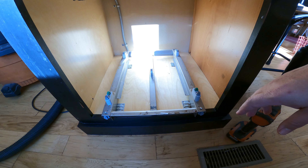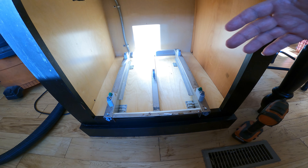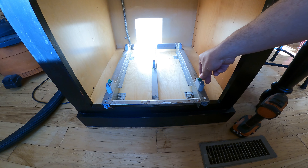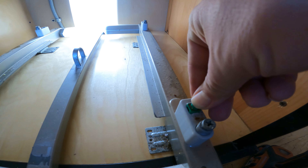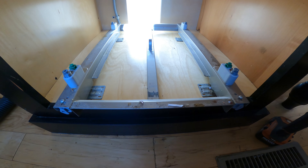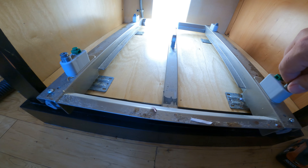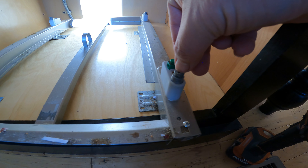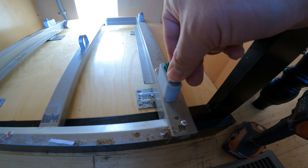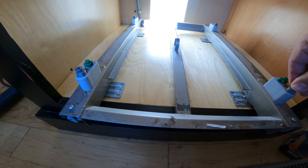I've already taken quite a bit apart because I want to show you the part that's actually broken. These things push down on both sides and when you push those down, the part that holds the garbage can will come off these studs. You need to use a screwdriver to turn these studs out just a little bit — you tighten them when you install it, loosen them a little to take it out, and then the whole garbage rack piece comes off the top of this trolley system.